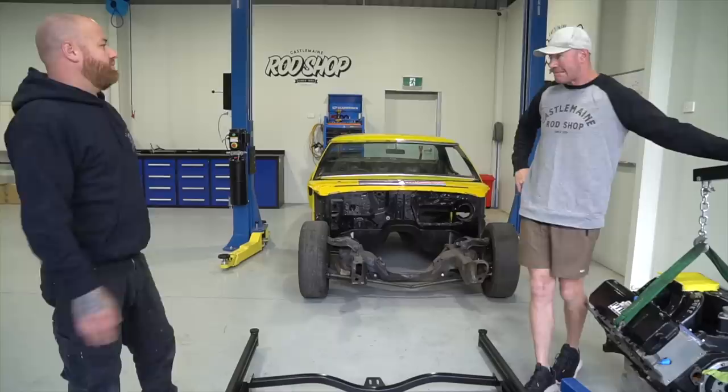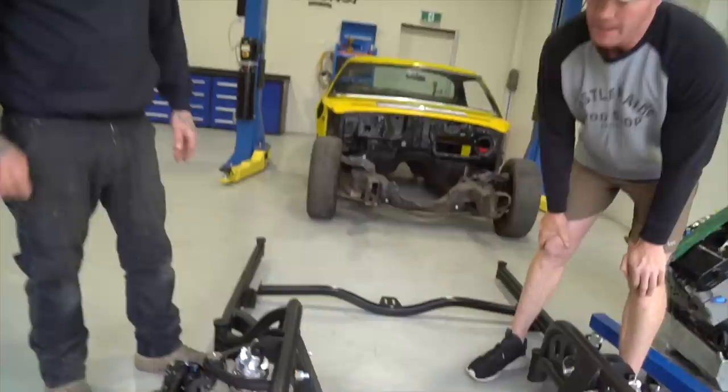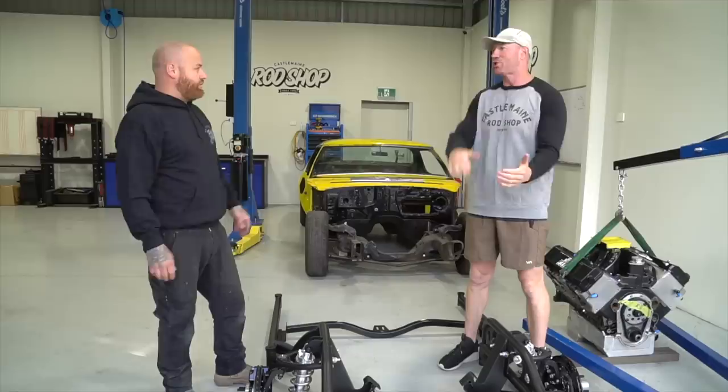As far as panel fitment, they've got a fully adjustable bumper iron, so you can adjust here for your rad support or up and down for your mounting pads. Okay. So obviously if you shim the body, if you want to get your panel gaps up, the radiator support panel adjusts to suit. Yeah, okay, cool, awesome. So that'll bolt in, that's great.